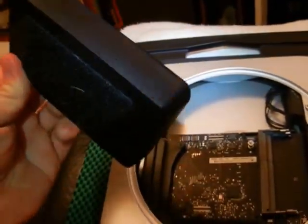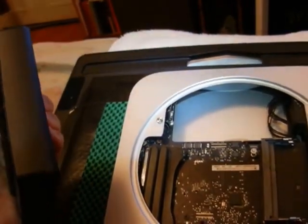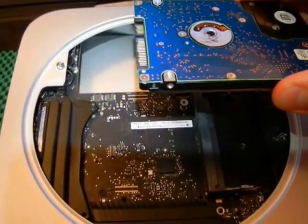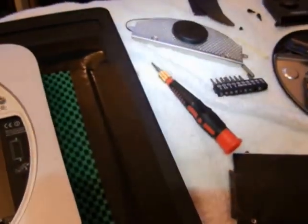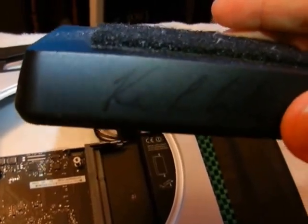You can go to Best Buy or order one online. Inside this USB enclosure casing is a 2TB 5400RPM Toshiba, made by Hitachi. The hard drive size in this is 15.2 millimeters thickness. Your standard 500GB or 1TB drives are 9.5 millimeters. The Mac Mini will support two of these — a Mac Mini server actually has two of them. Since this takes two 9.5mm hard drives, sticking in one 15.2mm 2TB hard drive is not a problem.